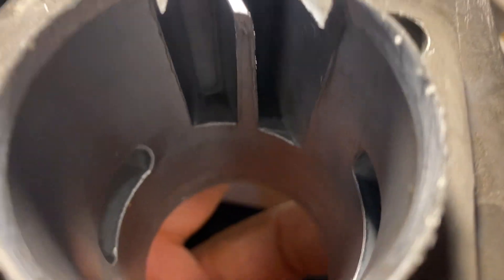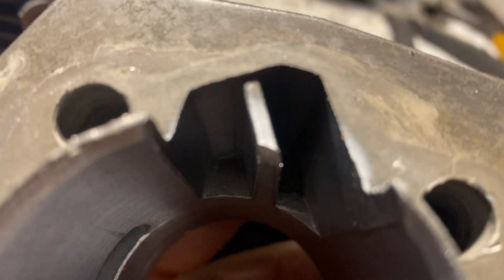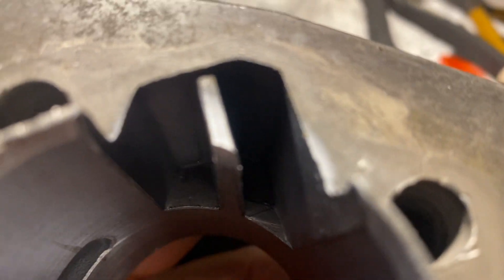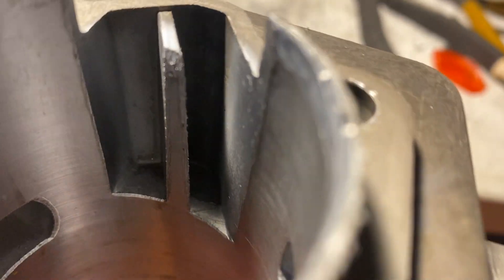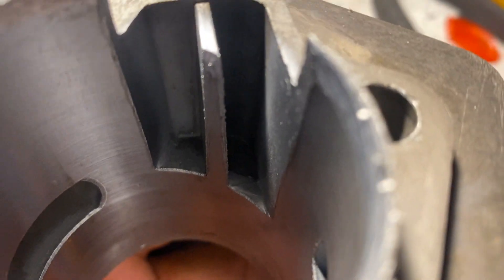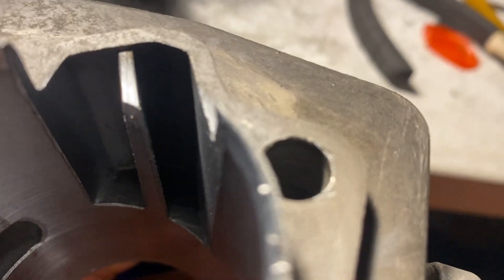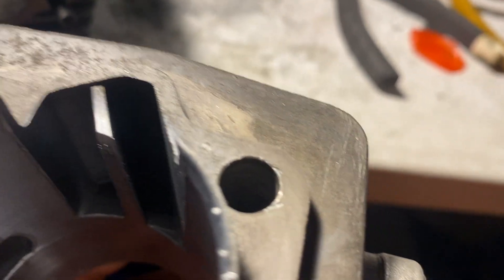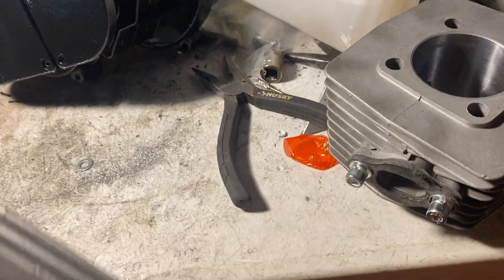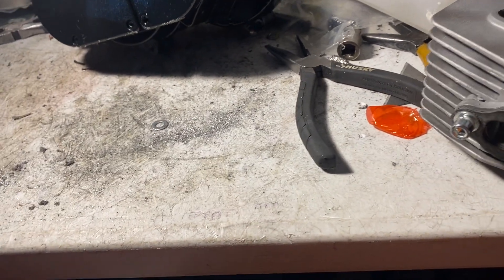So what I've done is started to dig back into those transfers and aim them towards the intake, where they need to be aimed, because that's the larger of the two transfers. But what happens is, just about as soon as you get to dig into the top of that transfer port and get it aimed well — to the point where it looks like it will flow well, and it will flow well — right at that point you break through the cylinder wall, because there's not much meat on these cylinders.